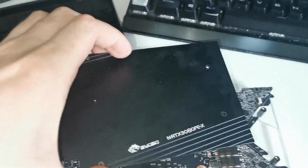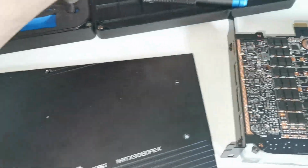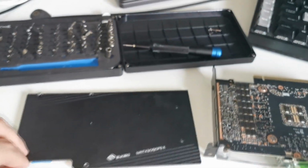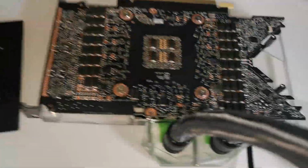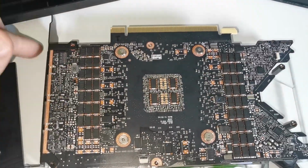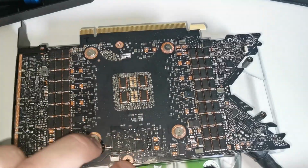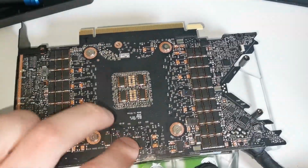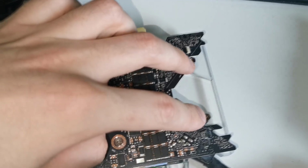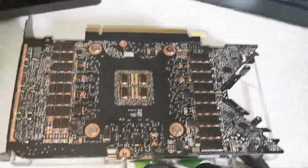The manual on the assembly of this water cooling kit does not have proper information about how you should use the screws and other elements. It doesn't even use the 3080 Founders Edition model. So it's important to see that there are 2 screws on the left holding the mounting plate, in addition to the screws you insert into the plastic. Also 2 screws in the middle that will tighten your contact with the actual chip. And there are also 2 screws on the back of the video card, which are not contacting the video card itself, but are just holding the backplate.